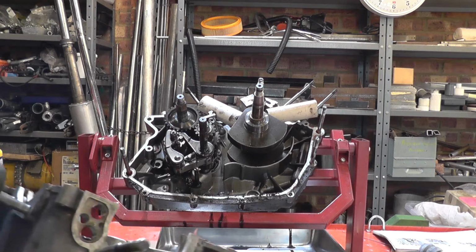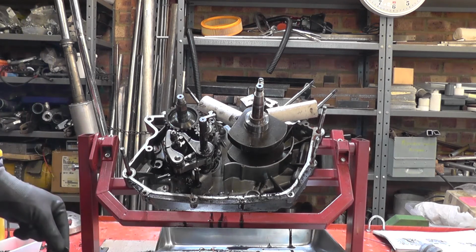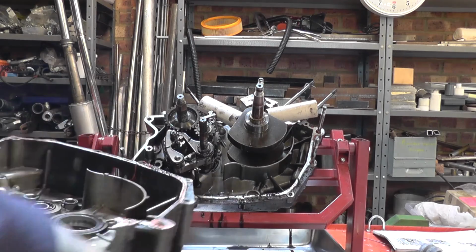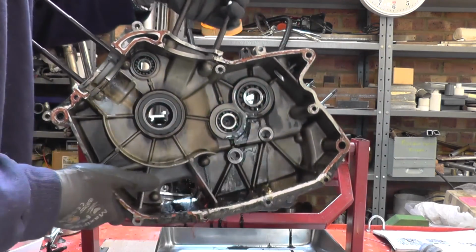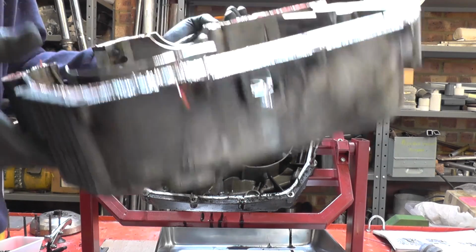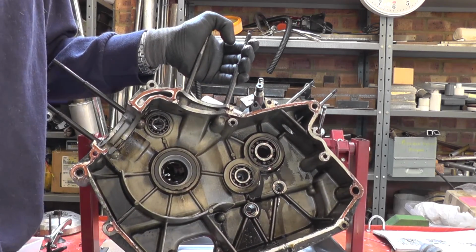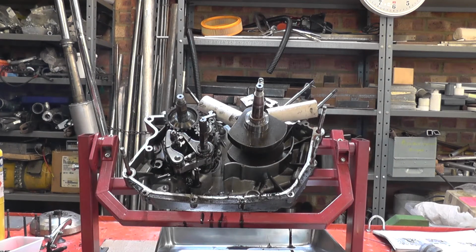So we've got a gearbox shim, so it's the shaft shim that we want to recover. There's no other shims hiding in the case. And there's a lot of nasty looking stuff down in the bottom of the case, but otherwise things are reasonably clean. So there's that surface that can leak oil through to the outside, that they changed later to put a seal in it.